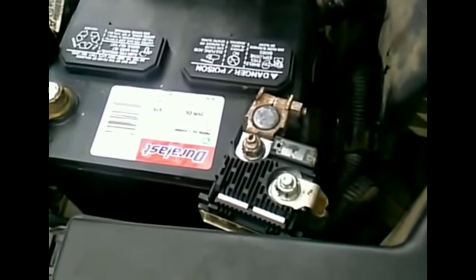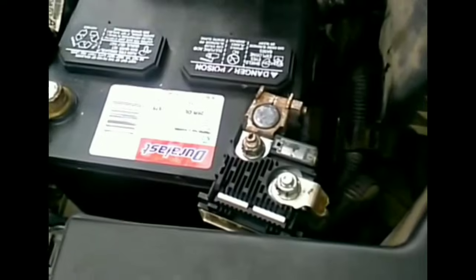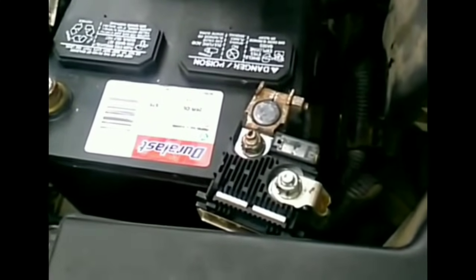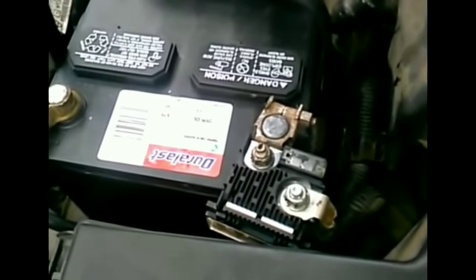So basically, that's the scenario I'm talking about in this video. If you get nothing in your car at all, no electricity, no chimes, your remote probably didn't work, you had to use your key to get into your car, it seems like your battery's dead, and if you try to jump it and nothing works, probably your best case scenario is to try that. If you have a wire brush, clean off the little fuse that connects the ring of the terminal to the rest of the fuse block. And if that helps you out, that's the fix for it in that situation.